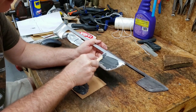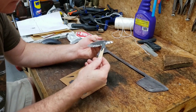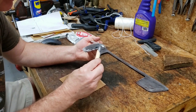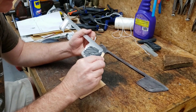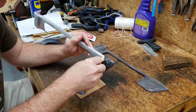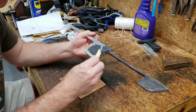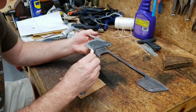The quick-weld sets up in about five minutes, and it takes about five minutes to apply a layer of epoxy to the entire piece. Then we have to string it up to make sure the veneer rests against the aluminum all the way around.